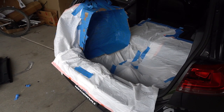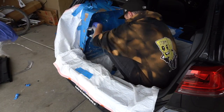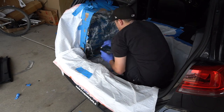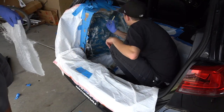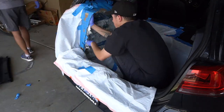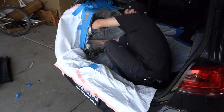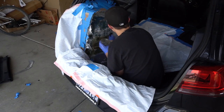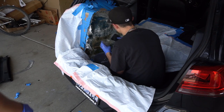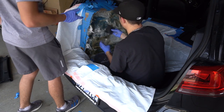We're going to get ready to lay the first layer of fiberglass mat. To lay it down I just got some foam brushes from Home Depot — we're using the fiberglass mat and you kind of just want to lay it down in sections as you go, making sure that you coat every little inch with the fiberglass resin using those foam sponges. Build up about three to four layers. The chemical reaction of the fiberglass hardener makes it hot — actually pretty crazy. Oh, that is hot!